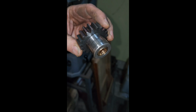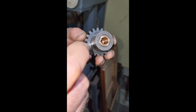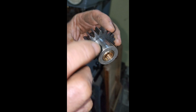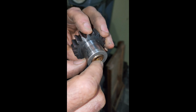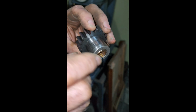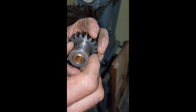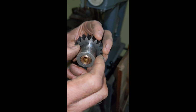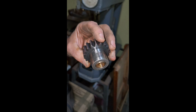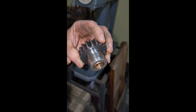But if this is a piece of case hardening steel, it's got a tough core and it's hard on the outside. I would say that the case hardening is very shallow. If I did that, I could do that 40 thou deep. And it would be like doing tool steel through hardening steel, because the hardness is now 40 thou deep. But at the moment, we're collapsing the core, and that's what's happening here. This is just collapsing.